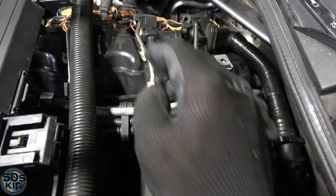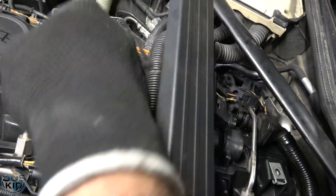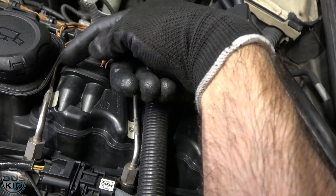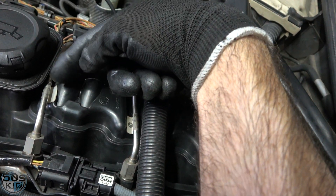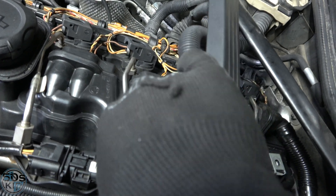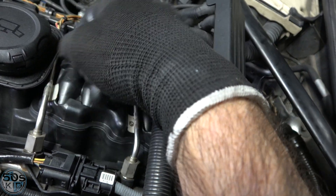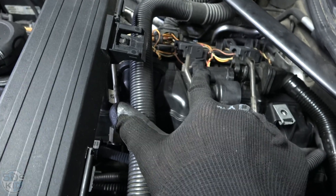On this system it's reversed. The crankcase vapors can only flow out through the PCV valve — boost cannot flow backwards into the valve cover. This check valve is basically a one-way valve: it lets vapors come out and lets vacuum suck out, but will not let boost push back in. The crankcase vapors pass through this passage, go through channels that lead to the intake manifold. All oil separation is done up here — the blow-by gases come up through these passages and condense on the walls of four cyclone chambers, so oil drips back into the engine and only vapors get through.